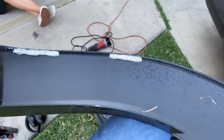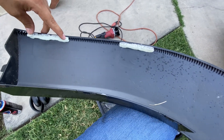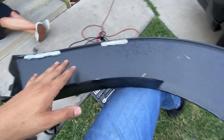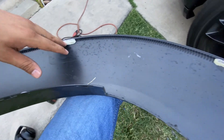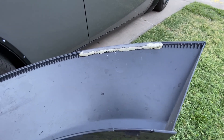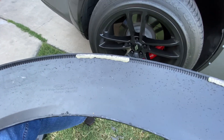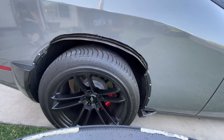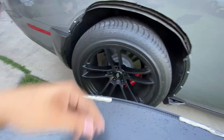The rears are done the same way I did the front flares. I did the plastic epoxy from JB Weld on certain areas, spaced out in between — that way it creates more of a hold for the 3M adhesive. With the super hold 3M from AutoZone it should definitely work. I want more security keeping it on there nice and flush — no flaps.